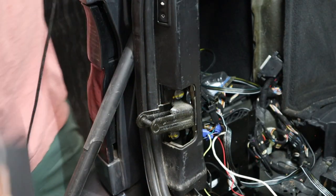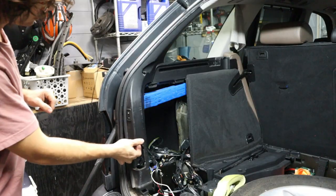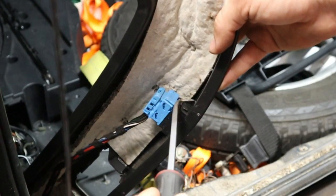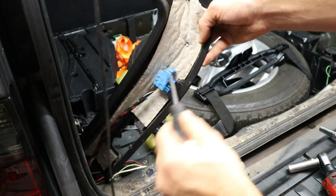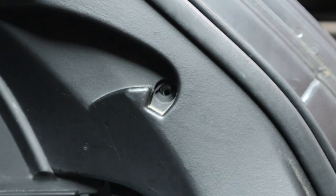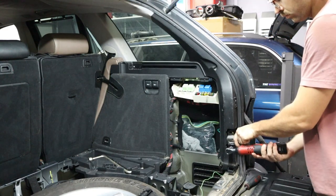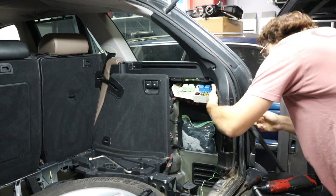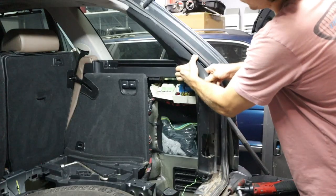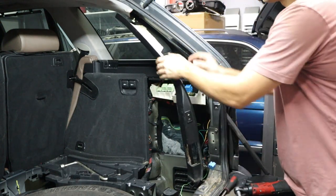As part of this upgrade, we are going to have to remove the door lock strikers here for the tailgate. Removing them means that later on we're going to have to reinstall and adjust them as part of the process because they don't just simply go into the same place every time. Once you've got that off, you should be able to get off this side trim piece — although I did kind of break it on the way. There's a switch on the back you'll have to unhook, but more importantly, there are a couple of screws that I missed. There's one up here that goes right where the cargo cover is going to land later, and then there's another one which I wasn't aware of because it was missing on my left side cover before, and I actually ended up breaking it. So learn from my mistakes and remove these two screws before you try to get this trim piece off. Then there's just a pop clip at the very top, so once we remove this switch, we can get this out of the way.